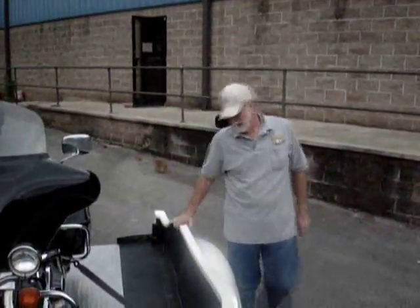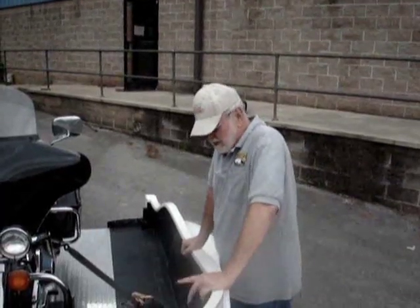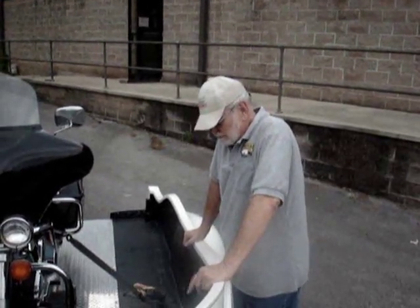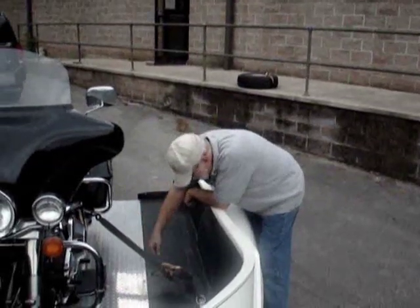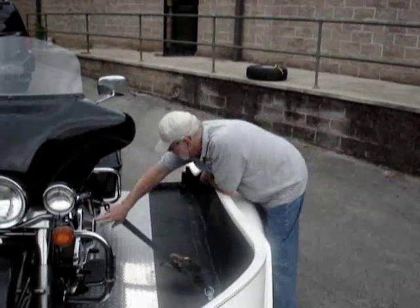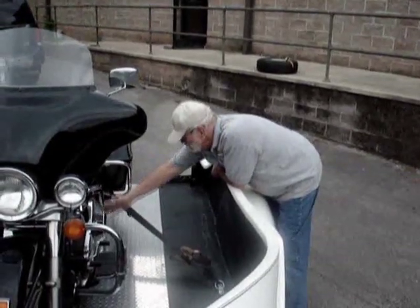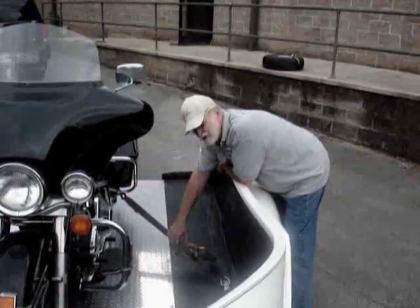This is the system that we've used to transport this bike thousands of miles. There are three elements to it. One is the drive-in step-off wheel chock. Two is the placement of the D-ring forward and out from the tie-on point. And third is the location of the tie-on point roughly 10 to 12 inches behind the transmission and at least as high as the midpoint of the transmission.